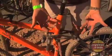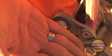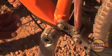When you get into big travel situations, you don't want to have crazy long chain stays or compromise the geometry in order to get that wheel to move where we want it to. We knew where we wanted the wheel to start and end, and then designed the front chassis around that, keeping the saddle, handlebars, and all the tactile components exactly where a rider would still want them to be. Coming down, you'll notice that, like when you saw the Compulsion, for example, the angle of the lower links is slightly different. And again, that leads into designing the chassis per intended use.